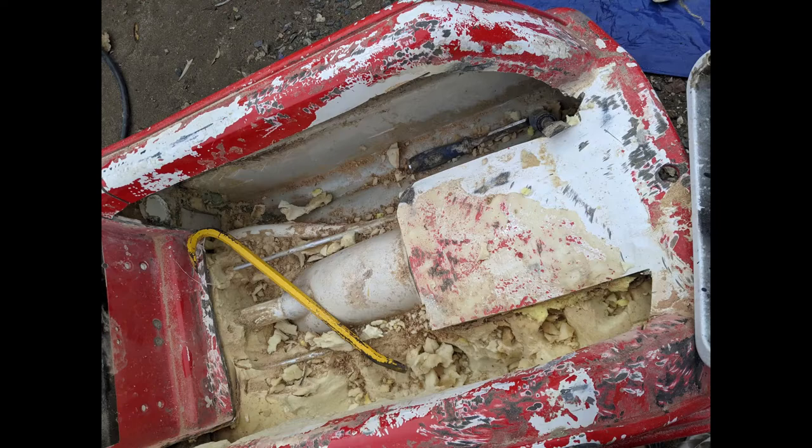So I made the cut at that point there. As far as the back, you could go a little bit further back, but it makes it a little bit harder with the way the back of the ski bends. Once again, I find that where I made the cut there is also good. The part that's actually hard to cut is the center part. I just left it in place, so I am using that as a reference of how high my tray is going to be, of where I need to put the new fiberglass. But you can also remove that center part.